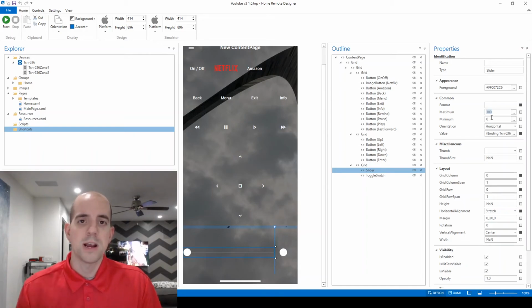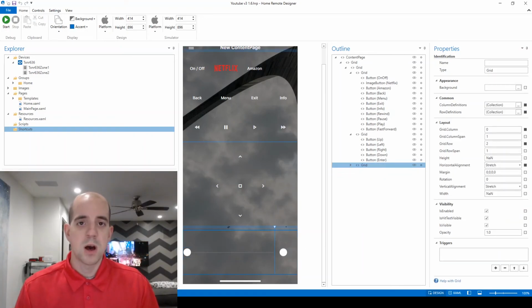Now on my receiver, I can actually go to negative decibels and positive decibels, but behind the scenes, the home remote is doing some additional calculations there to work with those numbers and get them so that they're still down to a 0 to 100 scale with one tick in between, and it's doing all of that automatically. If we were using some sort of custom integration here, we may need to adjust these values so that our slider control works appropriately.